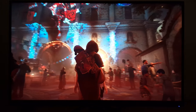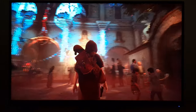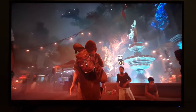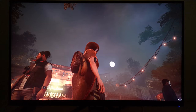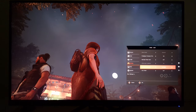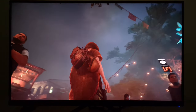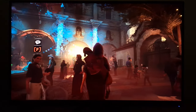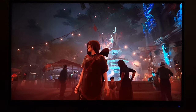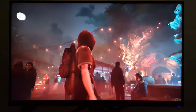There's also a flickering effect because of the little halos, as I showed on the desktop. The dimming zones readily transition between two states. It's more obvious with the lights up here against the dark sky, and also the embers and fireworks — you can see halos moving all around. Lowering to the average setting makes it less obvious and it doesn't catch my eye as much. For this reason I actually prefer to use average over fast — this is quite a torture test for local dimming solutions, and in some scenes the fast setting is just a bit distracting.